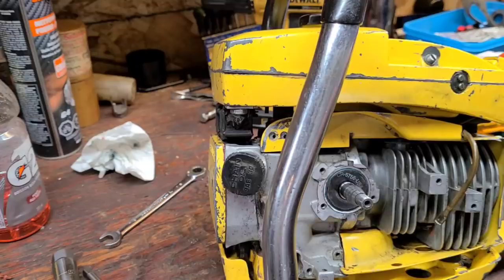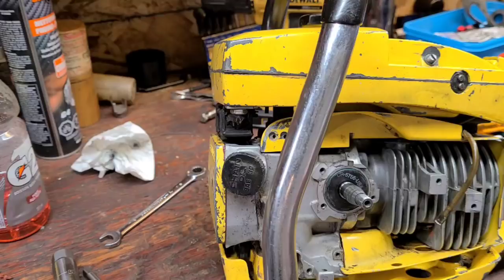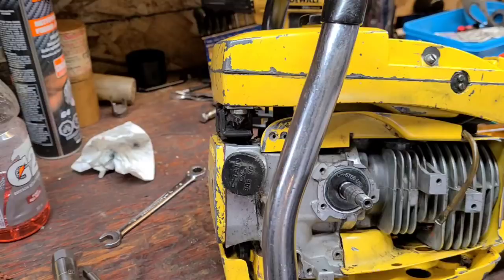The PTO side is, what brand is it? I want to say it's an SKF. But yeah, it's a 6119 or a 6120, I think. I got that right, folks. The 119 is a single lip. The 120 is a double lip. That's the other side.